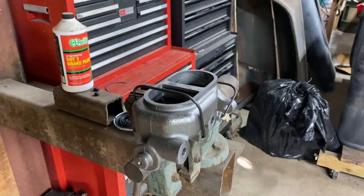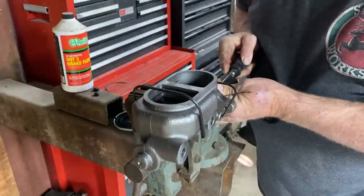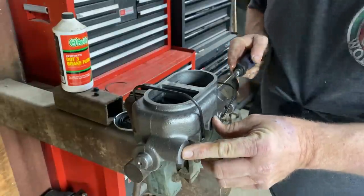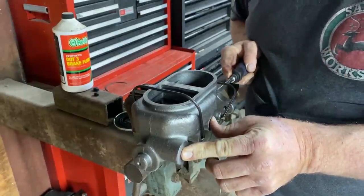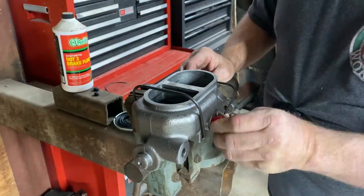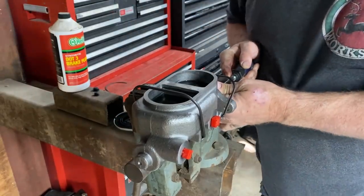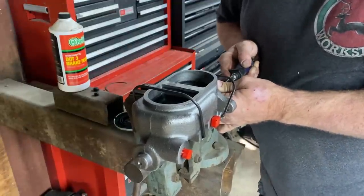All right, we're going to try this voiceover thing here. This master cylinder came with the car — it was brand new, still wrapped in plastic. I have no idea how long he had had it, but that plunger felt like it was trying to hang on me, and I was very concerned with that. So I tried to prime it, get it moving, and get it lubricated up before I started actually priming the master cylinder. That's why it looks like I'm not quite doing it by the book. But it got to working, and I saw no leaks.